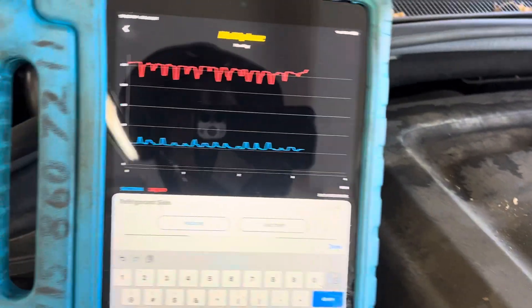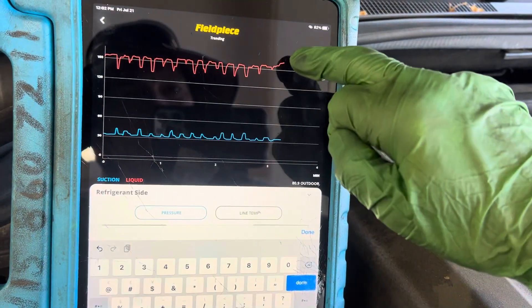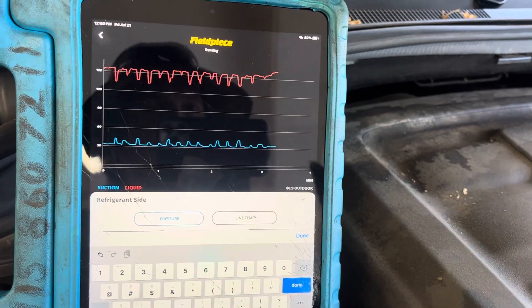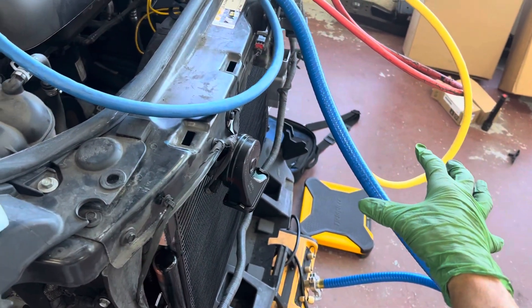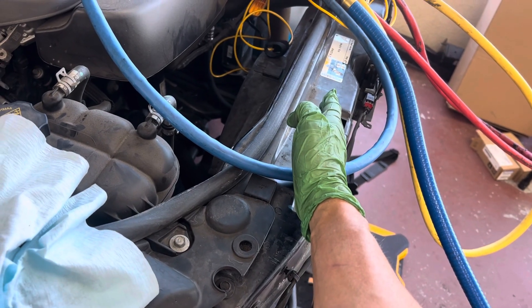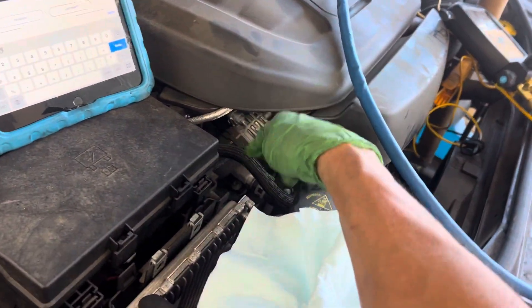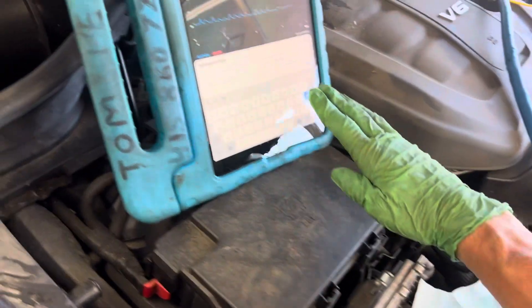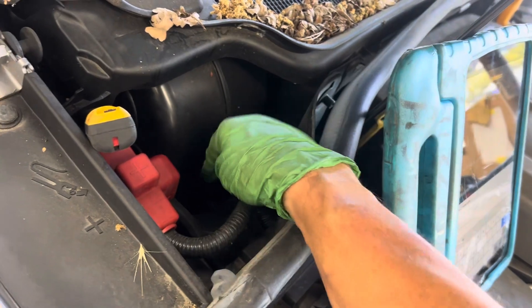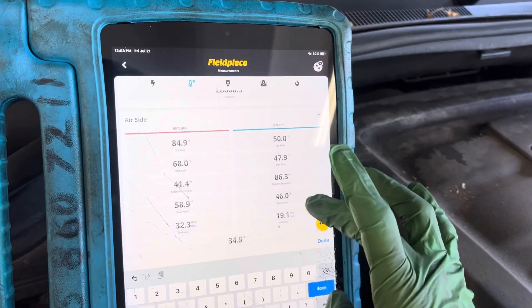You should start seeing a difference here in the pressures because this is on the pressure screen. You see how the pressure is going up right there? Because we're putting a heat load — it's sucking in not only the 77-degree air from here, it's going through the heat of the condenser, picking up some temperature on the air, going through the radiator, picking up some temperature, going over the hot engine and exhaust manifold, and this air is coming up and being sucked around right down in here. And you should be able to see that temperature difference.